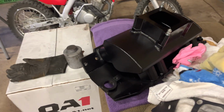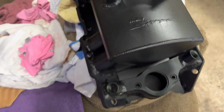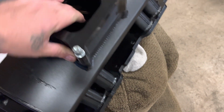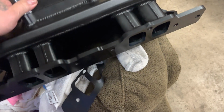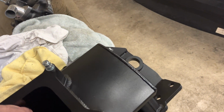So I was bragging about this Holley Sniper intake. Obviously the 2-inch spacer, but anyways, the Sniper intake. Everything is fine and dandy. It's way lighter. But the negative side I didn't remember until trying to put this on when my son was lining it up. It's square port to oval port. Can't use it.